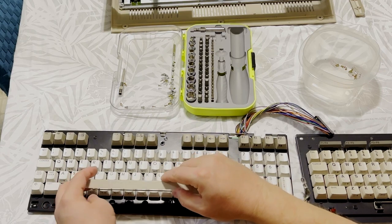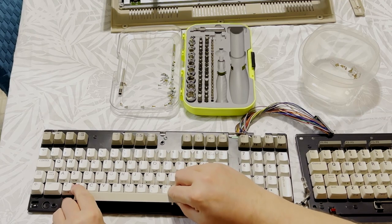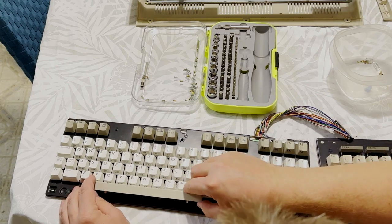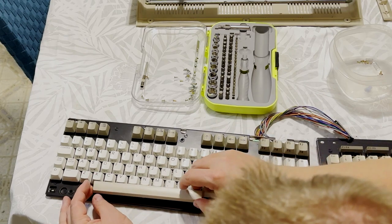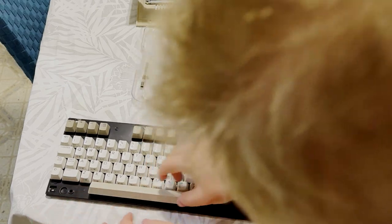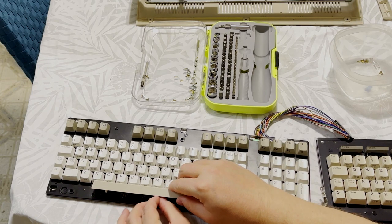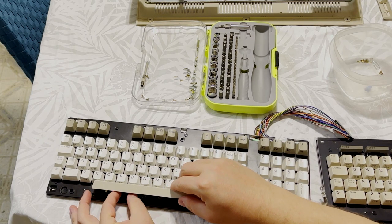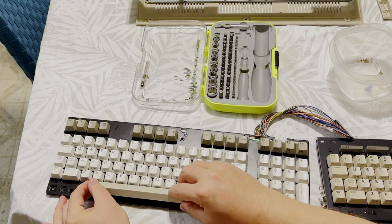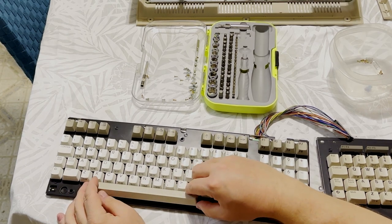So we're able to get this spacebar in here. But I first try using the plunger that came with the 128, and that is just not fitting right. The springs fit. The guide rails fit. The key itself generally fits, but it will not fasten into that plunger. Yeah. Nope, Gord, you got it right there. They're just not quite a good fit. Fortunately, we've got lots of plungers on that Plus 4, and we can steal the one from the spacebar.